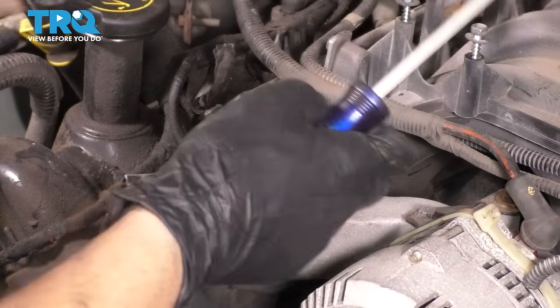So now the last thing to do is to put on the tensioner over here. I have it ready with bolts. Pull the chain up, pull the guide up. Everything is lubricated with oil. Make sure the tensioner slides underneath this guide here, just like that, perfect. This bolt started in. This one just started in as well. We'll bottom these out, torque them to 18 foot-pounds, and the chain is on, the engine is timed.